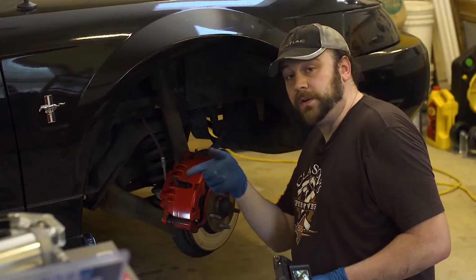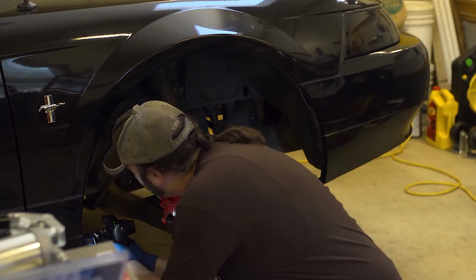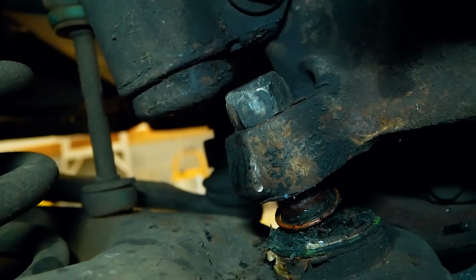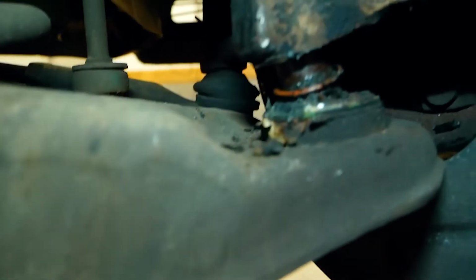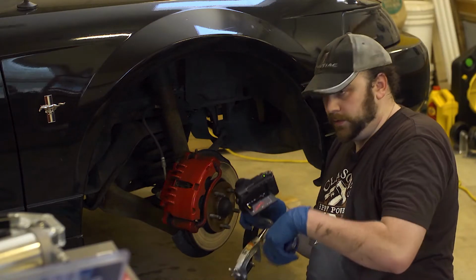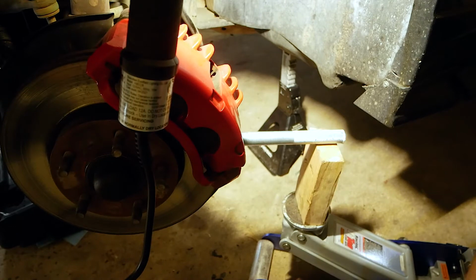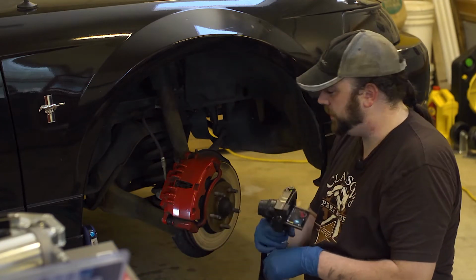Right, so what you saw on B-roll with the floor jack worked, just not the time I was shooting. Maybe this camera angle might work. From this angle, you can take a look that we did separate, and now it is pushing up against the nut there, which is not a castle nut. That concerns me. Basically just hammered the pickle fork in until it wouldn't anymore, and then I got the jack underneath and, oh! It worked, yeah.